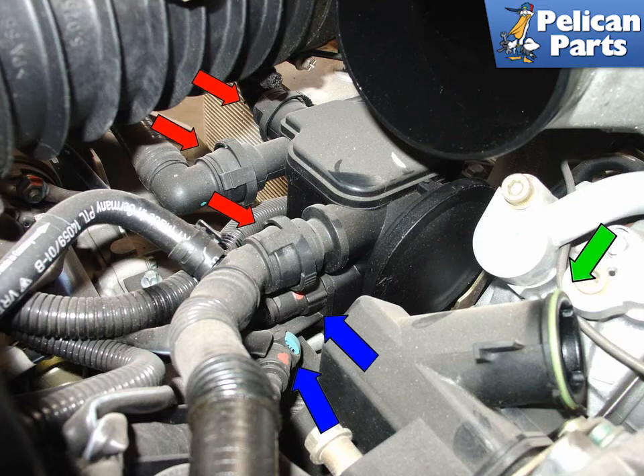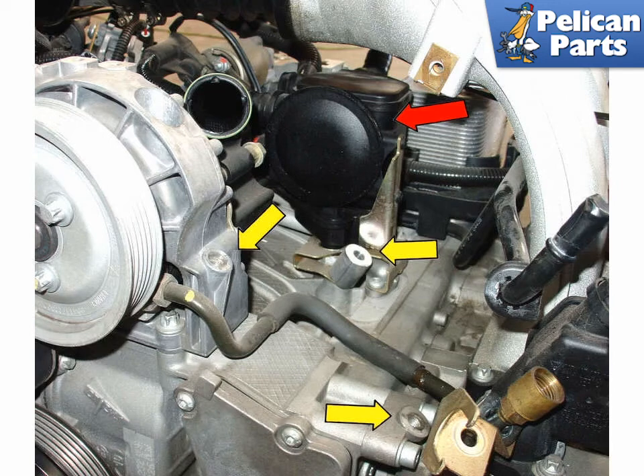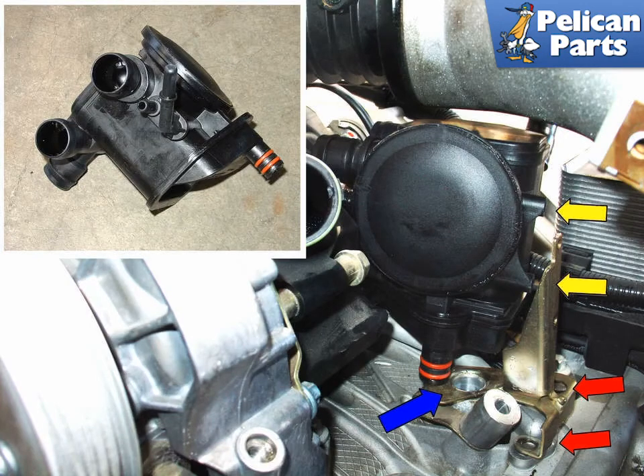The AOS sits in a tube that connects directly to the crank case. Be sure to clean up all of the coolant before removing the AOS so that nothing gets into the case. This picture shows the air oil separator with the AC compressor removed. The AOS is shown by the red arrow, while the yellow arrows show where the bolts that hold the AC compressor go. The AOS has been removed from but is still sitting in its mount — the blue arrow shows the opening to the crank where it sets. Make sure you place a clean rag in there so nothing can get into the crank case while you are working.